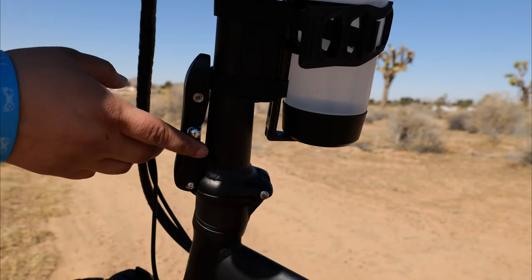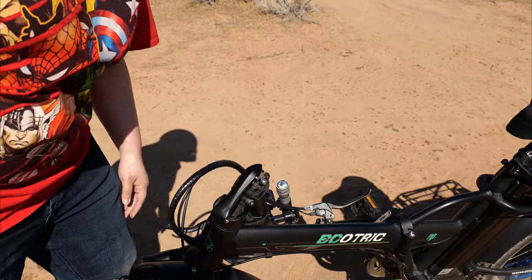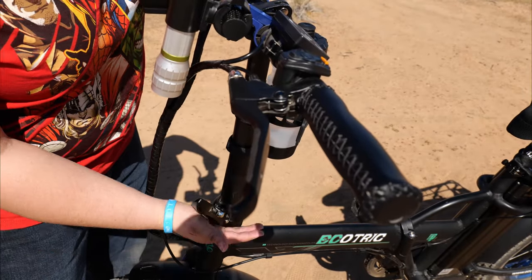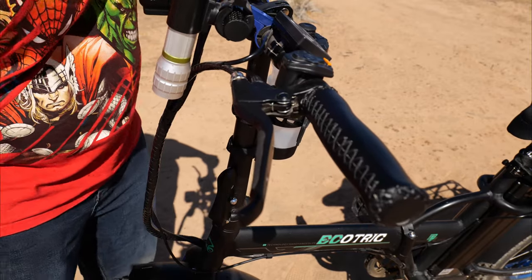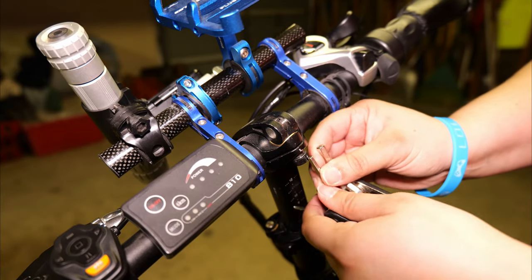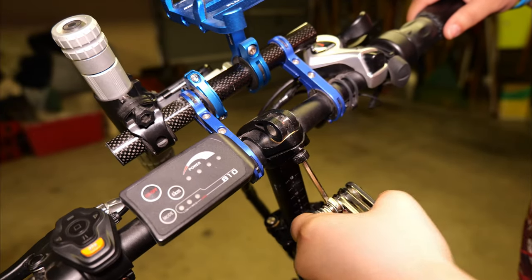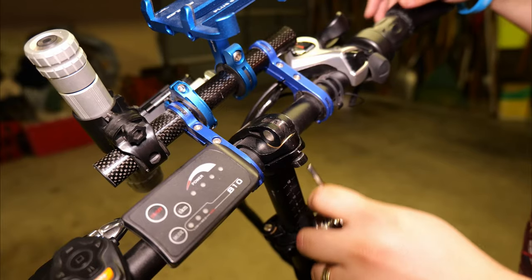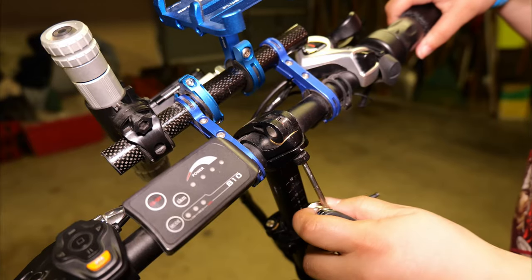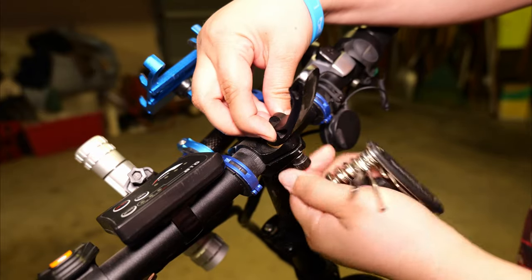There's a stand that the bike sits up on when it's folded. The handlebars also fold down — just pull up on the lever and fold them. The handlebars are also detachable. To take them off I use a four millimeter allen wrench because if you just hand-tighten the bar it tends to move while riding, so I definitely use the allen wrench to tighten it down.